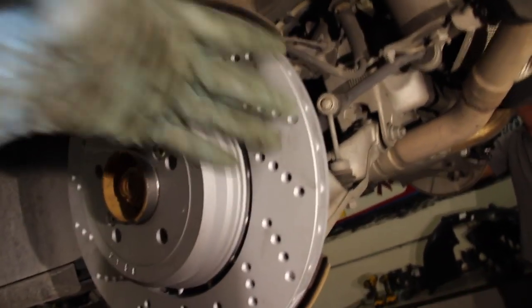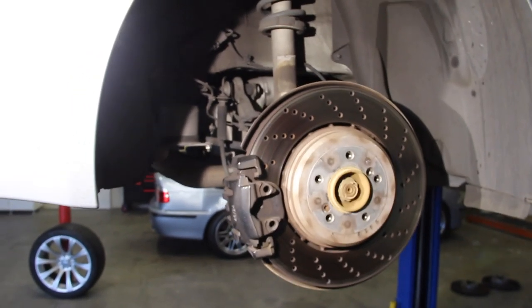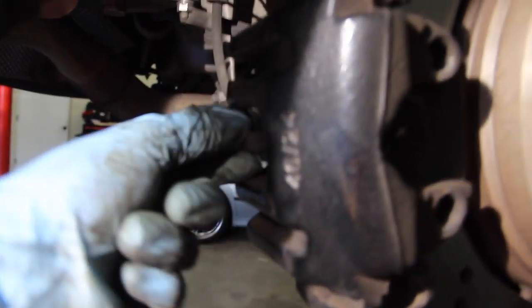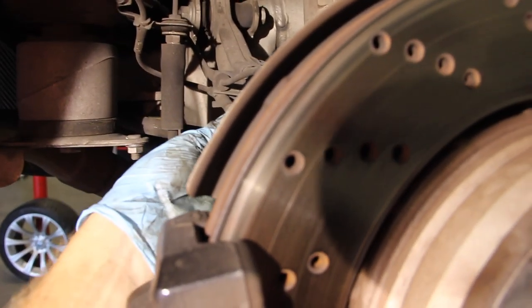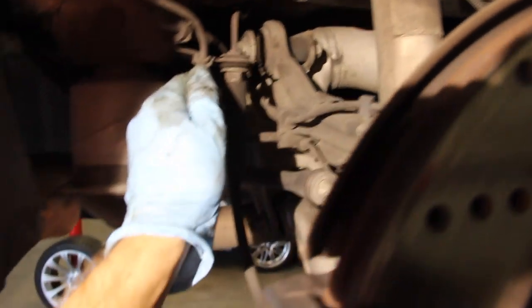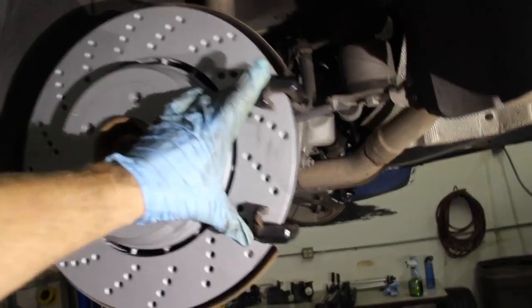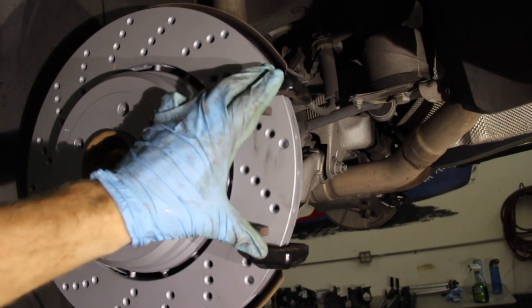With the rotor on, I'm going to take the carrier and it's the same deal as the front - put the carrier back on, clean up the caliper, pads in the caliper, caliper on the carrier. Here on the rear passenger side, the only difference is going to be the pad wear sensor, which works just like the front - it's sticking out of the side of the caliper. You'll wiggle that out, there's a little cover on the nipple just like the front, then follow the wire through a bracket behind the brake line and then into a little trap door up here just like the fronts. The torque for the rear carrier is 48 foot-pounds at 18 millimeters for both sides. The torque for the guide pins in the rear is 21 foot-pounds.